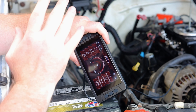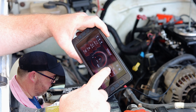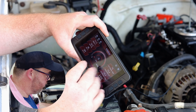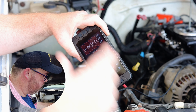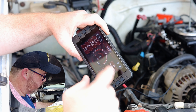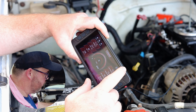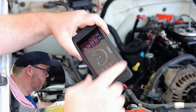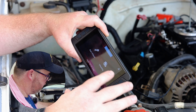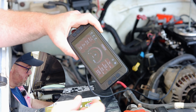We've done some basic adjustments, turned the vehicle off. Keying it back on, we can see the IAC position is at 74 — this is the parked startup position. If you have a heavier cam you can go into the parameters and adjust the IAC park position up. If you need more air on initial startup because of a cam, you can change this position value higher or lower to suit your engine needs. After making those adjustments, go back and zero the TPS to make sure zero is zero.